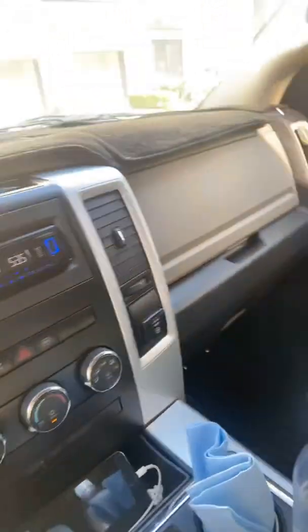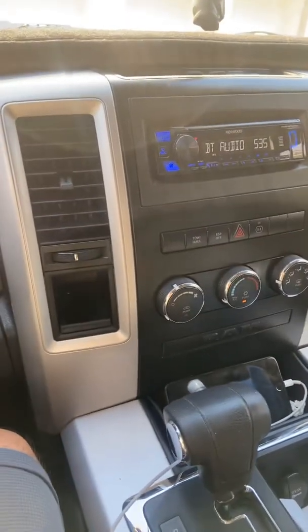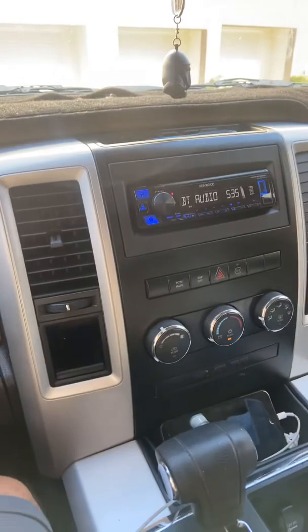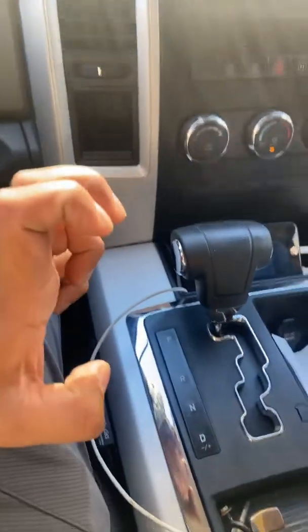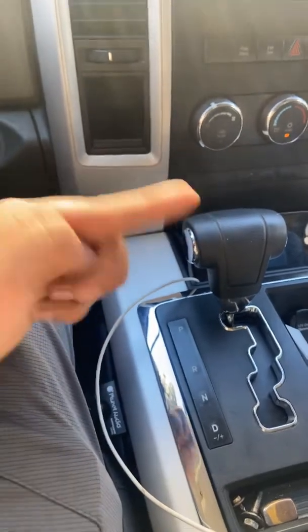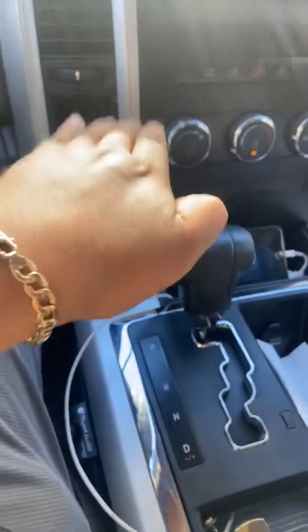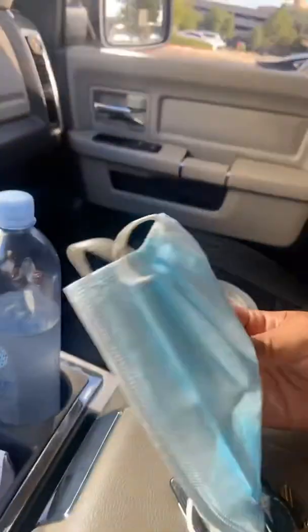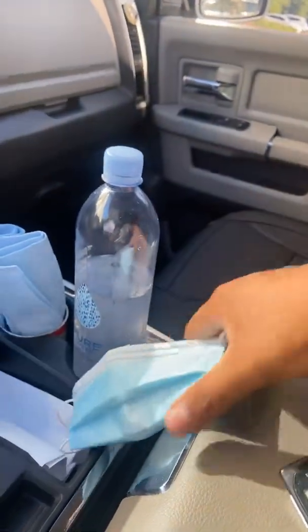It's amazing the difference. And I can't find any information on this for the 4th gen Ram. There's a shitload of 3rd gen Rams. They actually have a door that's controlled by this little actuator here that controls a pin, and the door goes boop boop boop boop. Well, this one controls a whole shroud, and the shroud pretty much goes recirculation off, recirculation on, and blocks the outside. It's a terrible diagram right there.